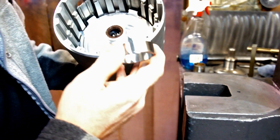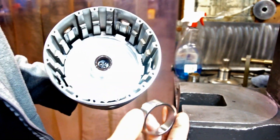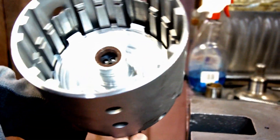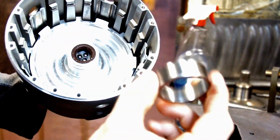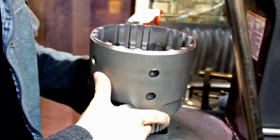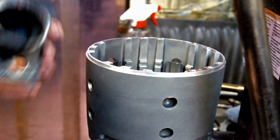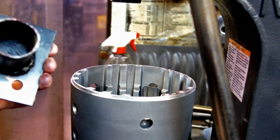My name is Barry, I work here at PATC as one of the builders. I'm going to talk to you about this sleeve that goes on the overrun. I've built it up so far to the forward piston. It's easier to put this in next before the last piston goes in. We're just going to press this in — I've got a tool made, it's just an inch and a half piece of tubing welded onto a flat plate, works really good.